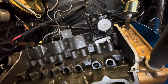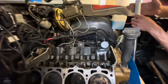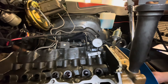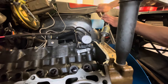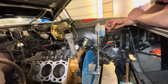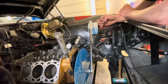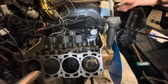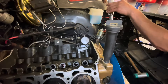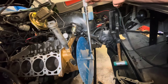This is just designed to get you close — the real measurement is when you measure on both sides of the lobe. Okay, that's it. Now move it forward and go to 20 before it hits zero, so go until it hits 80. Right now we've got 24 degrees, so I'm going to write down 24. Keep going past zero and then go to 20 on the other side of zero in the same direction. There — we have 80.